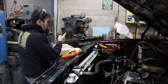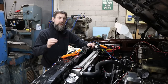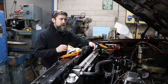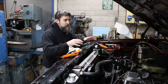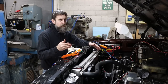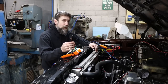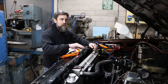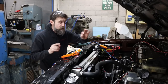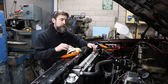Let's talk about relays for just a second. I'm going to install a relay on my fuel pump power wire so I can eliminate the need for the ECU — the computer of this Holley Terminator X-Max Stealth system — to have all that excess current running through it. Holley recommends that if you're running an electric fuel pump that's over 15 amps, you do this anyway. My fuel pump's not over 15 amps, but just to be safe, keep the current draw on the ECU down and let the relay do the hard work.